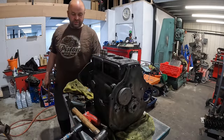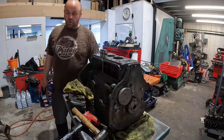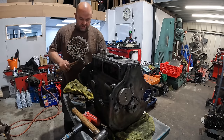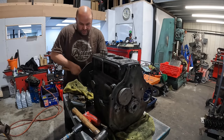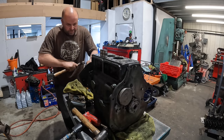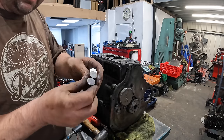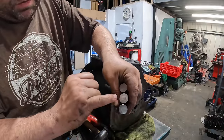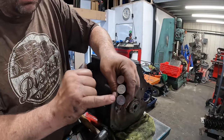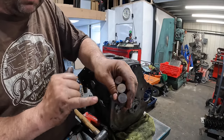The next thing I've noticed on this 1100 is someone has been in here before and changed it from a simplex single timing chain to a duplex double timing chain. They've siliconed all the front cover on, which is fine. The cam followers are showing real bad corrosion and pitting, so I should imagine the cam is also in bad condition. I'm going to save these to show to the customer.